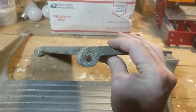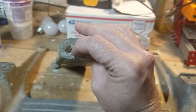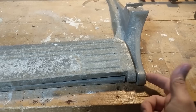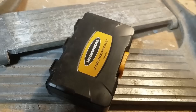What we have here is galvanic action — dissimilar metals, steel and aluminum. In the presence of road salts or any salt and water, there's a slight electrochemical difference between those two metals which causes them to fuse in a terrible way. It's really bad corrosion. So I need to somehow extract the harder steel out from the softer aluminum, and I've carefully centered a drill and drilled out as much of that steel as I can.